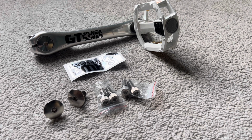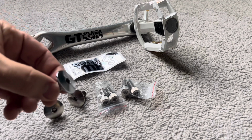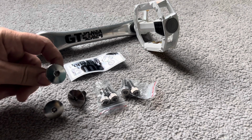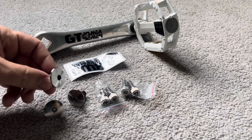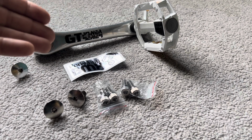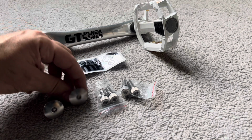As you guys know, these spindle bolts are basically just mild steel, and they were chrome plated, and a lot of them didn't survive. They either got pitted, rusted, stripped out. This one happens to be in really good shape. The hex is really well defined. And so Porkchop has created a reproduction of that. They are made out of titanium, so he went to the next level.